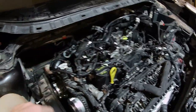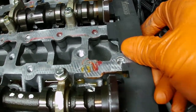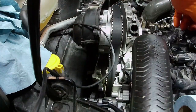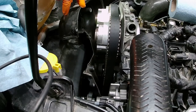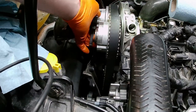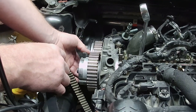Getting this torn back off — looks like the exhaust is slightly off as well as my intake. I'll break the tension loose, get the caps off, get all that out of the way, take the bolts out, and then line up our phasers. I keep saying cams, but we have the phasers with our tool here. We'll get those lined back up — both phasers and tools are in.